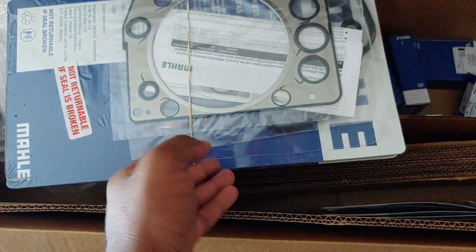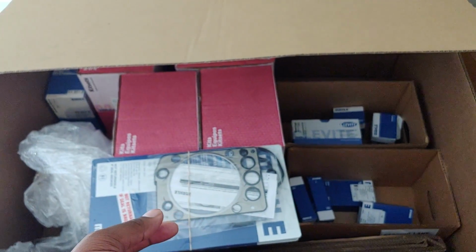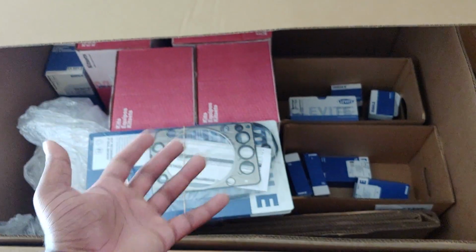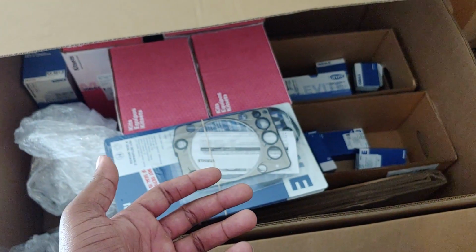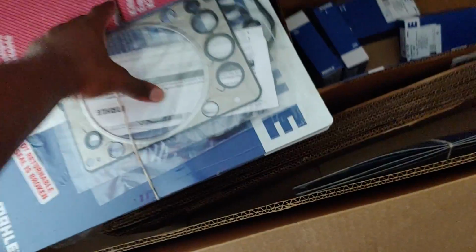These head gaskets, this is a new version of the head gaskets. Now, I can't really explain, so I don't know, but apparently Mercedes-Benz back in the day, they had head gaskets that were failing on a lot of engines. Somewhere along, I guess 2006 or 2007, they designed raised head gaskets. Okay, it's a newer version of head gaskets, which is what these are. These are the raised models. So that's the ones that I got now. And in order for you to get those updated parts, they gotta have the engine serial number. Now, if I had a 2003 or 2002 Mercedes-Benz, I wouldn't be able to get the raised versions because they didn't make the raised head gaskets for that particular model of the engine, to my understanding, if I even explained that right.